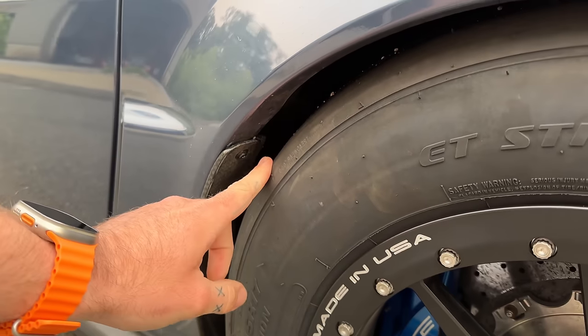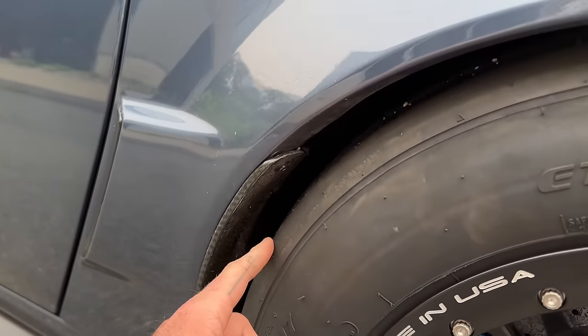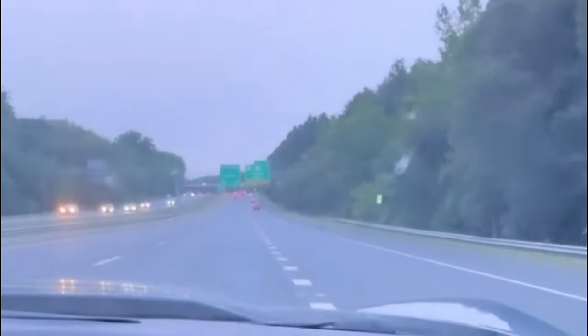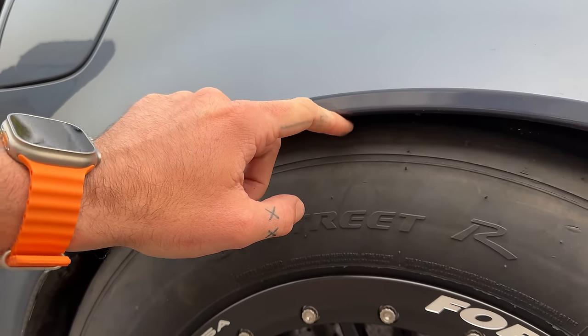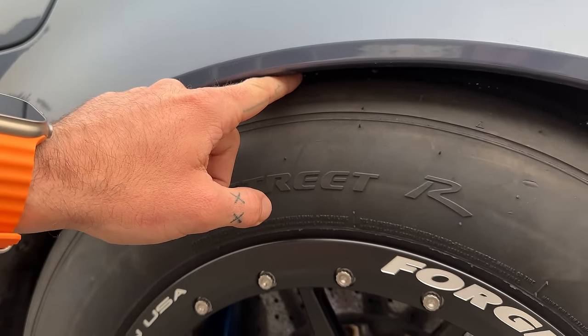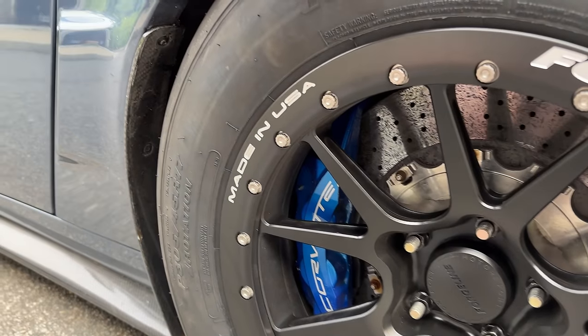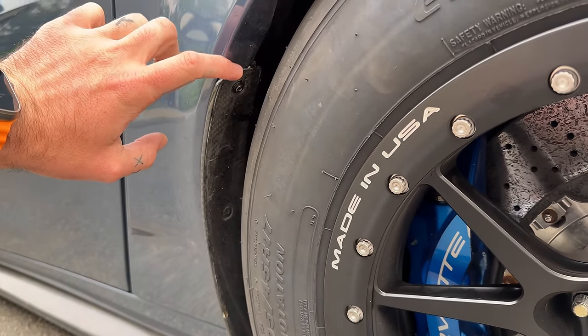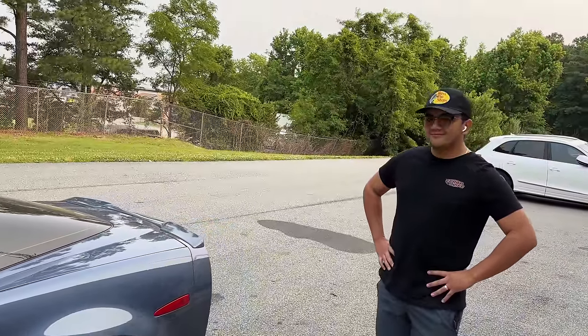I did decide to go out last night and do a little bit of on-road safety checking, and it turns out that we're rubbing pretty good. We left a ton of rubber on the upper side skirt piece. So we have a couple options. As of right now, the fender sits down below the tire slightly, so I do want to raise the car up — I think that's necessary. Unfortunately, it's not going to be the easiest thing. In addition to that, I think we're going to go ahead and cut this side skirt piece here just to take that out of play.